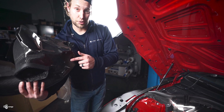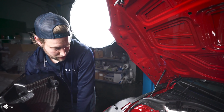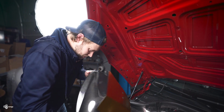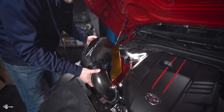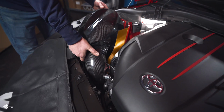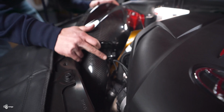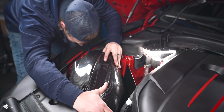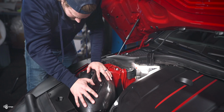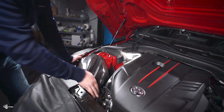And on the back there's a little plate because EVENTURI is coming out with this new air duct that's going to actually replace a headlight. So cool stuff coming ahead. But for today, we're going to just aim this down. Just very carefully navigate everything into place. I'm going to make sure that I have these 2 pins lined up with the grommet. You just slowly rock that into place.